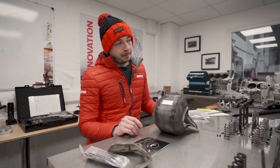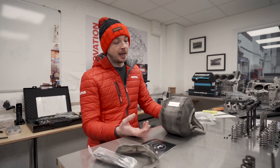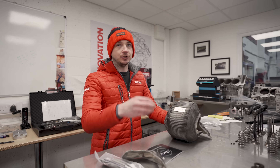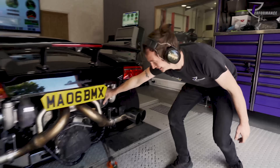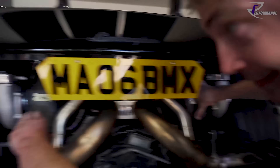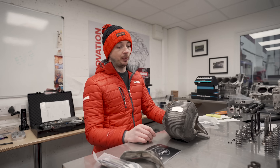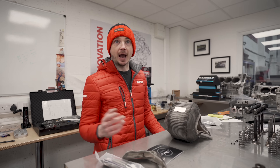It holds it all in the hot side. You do get some performance gain from that - at our level it's probably marginal or difficult to measure, but essentially hot gas moves faster so your spool time is lower. That's why you see downpipes on naturally aspirated stuff wrapped and lagged, because you get the advantage of faster gas flow out. For us it's the heat control into the rest of the car and into the other side of the turbo - that's the biggest gain and it is huge. Like I showed in that video, I can get out of a 900 horsepower pull and put my hand on a turbo that's nearly a thousand degrees.